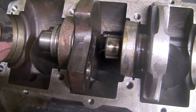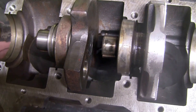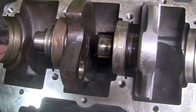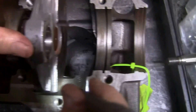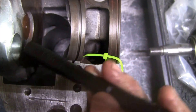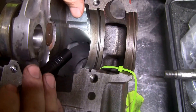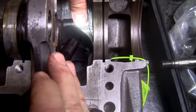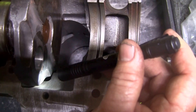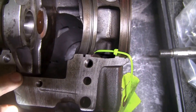Today the philosophy tends to be: get more air up into the combustion chamber, because that's where the magic happens. Let's get more airflow through and not worry so much about low-end compression — get as much air as we can up top side and work with that. That's really the whole concept behind this crankshaft. A Monte Carlo crank almost covers that rear inlet all the way. You've got these little notches designed to help airflow, but the front transfer has so much room because it's cut away. The rear one is where we really get starved, and by using a Monte Carlo GT in the rear, you limit how much airflow you can get through that rear transfer port.